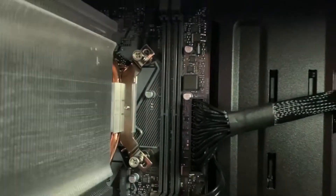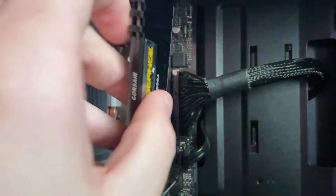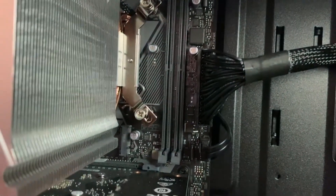This is literally going to be the easiest upgrade you're ever going to do to your PC. You're literally just going to slide these right into the slots where you removed the previous RAM sticks from. It can get a little touchy trying to get them in there, but you'll hear a snap and that's what you need. Keep both levers up and slide them right into those little ports.